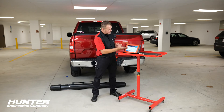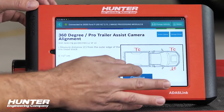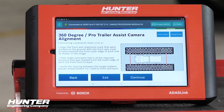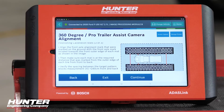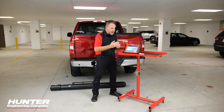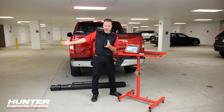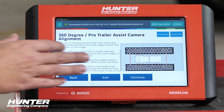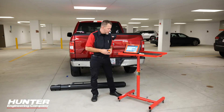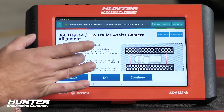We've made all our marks 17 centimeters away from the edge of the tread block on each tire. Make the line a little longer so it's easier to line up the mats. Now we start laying out the mats, aligning each mat with the front and rear lines we just made. Make sure you have at least 240 centimeters of mat overhanging both front and back of the vehicle. I'm going to take the mats from our kit and lay them down on both sides of the vehicle.